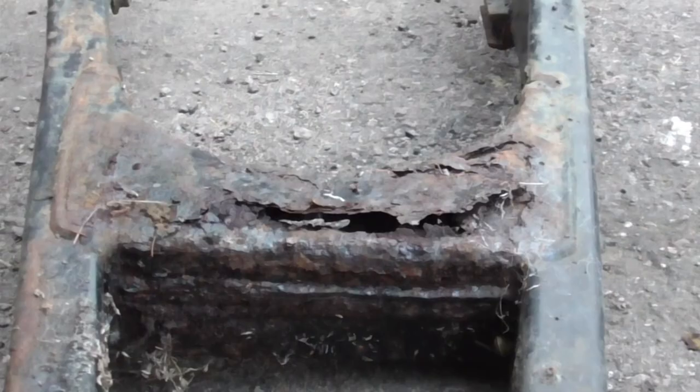Another thing to be wary of — have a good look at the underside of the swingarm. This is from the one I was knocked off of and you can see there's a lot of corrosion. The bike had done over 100,000 miles and was 18 and a half years old when I was knocked off, but this is actually an MOT failure. One of my mates had worse corrosion than this and his bike failed. It's a gusset plate so it can be chopped out and replaced, but get on top of the rust before it gets on top of you. Smoothrite with 10% thinners to dilute it is a perfect match for the black Honda frame paint.